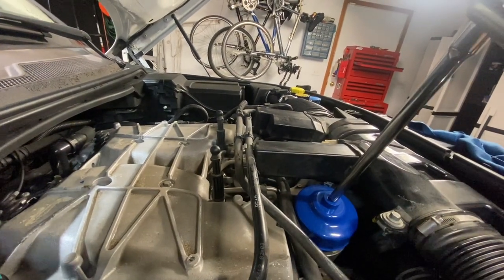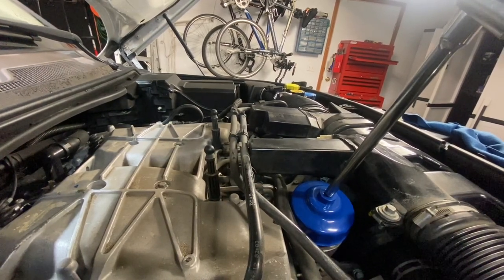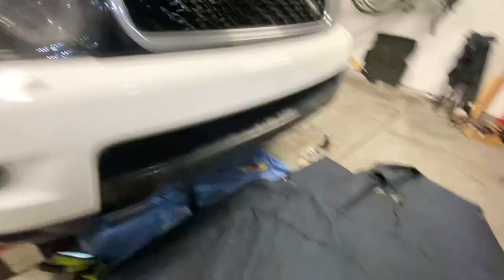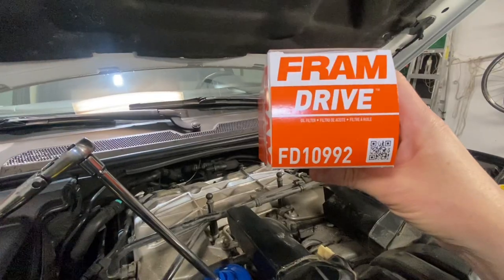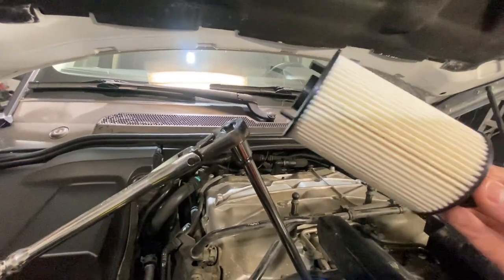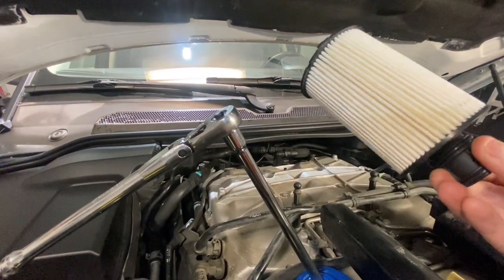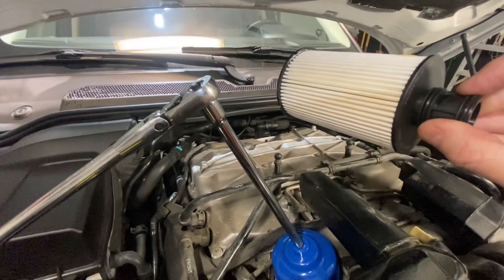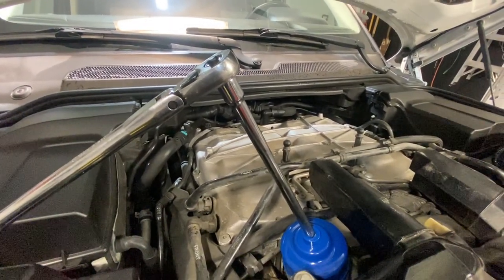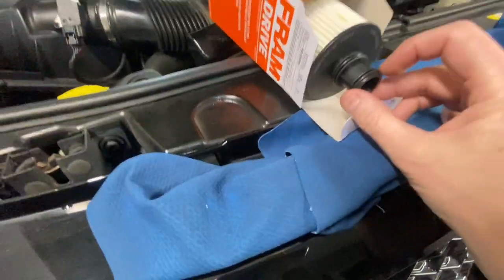Underneath the cap there's a plastic container and it uses a paper filter style of oil filter as opposed to the metal canisters that you throw away when you're done. This will actually come apart and you put in a new paper filter. The paper filter I got from my local parts store is an insert that goes inside — probably a little bit kinder on the environment since you don't have to throw away a one-use metal canister, but not necessarily kinder on your wallet. This was also about $25 and it comes with a new O-ring.